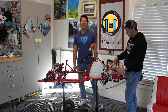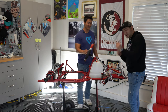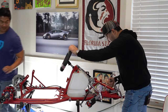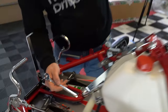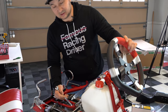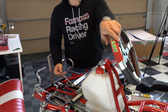Spin it on loosely first before putting a wrench on it, so we do not strip out the steering column. These steering columns are really expensive — we've probably gone through four or five in the last four months, so please be careful. I like to use the box end side of the wrench to hold it, then counter with the steering column. You can fit the ratcheting end underneath and tighten it by holding one hand on the steering wheel and rotating back and forth. Get it snug — we've got a working steering wheel.